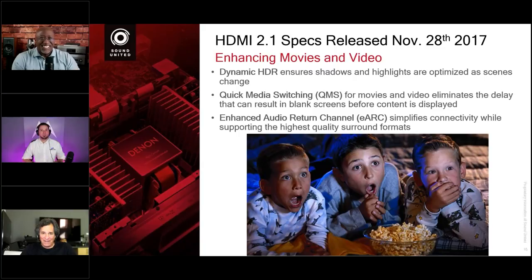I'm also cheating. The projector I have, and a lot of laser projectors actually, modulate the laser, so dark scenes get darker. So I'm kind of doing on the fly what Dolby Vision in the cinema does by design and with true metadata, to turn off the lasers. The downside to running this, by the way, if you guys want to play with this, I never thought I'd ever use it, and it works good on dark scenes.